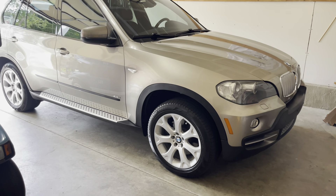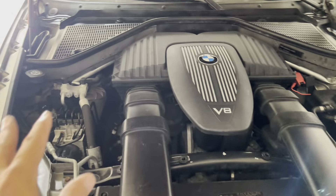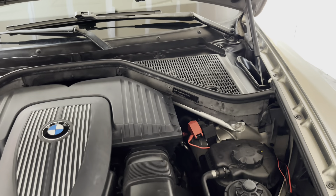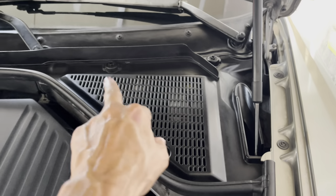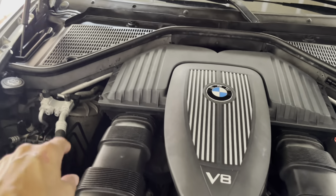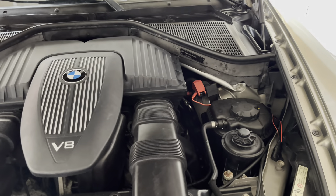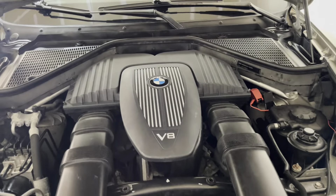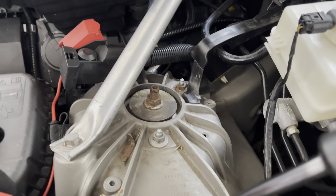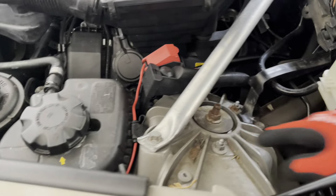Let's get this car up in the air, get the hood up and start taking things apart. So the next thing we're going to do is undo and pull out all these plastics. 13 millimeter here - pull these out, pull the panel up. You might want to go ahead and pull up the gasket all the way around, and then I believe it's 10 millimeters to undo these panels here all the way around. Some people don't do this part, but I want easy access. All the plastics have come off and that has revealed the strut bolts.